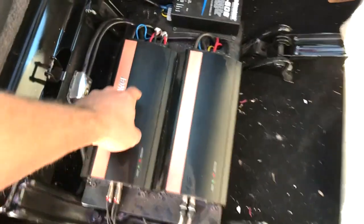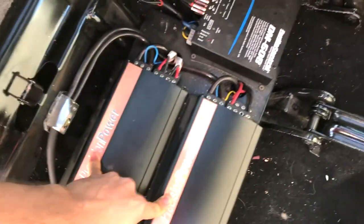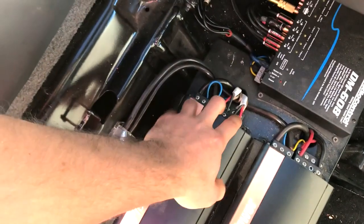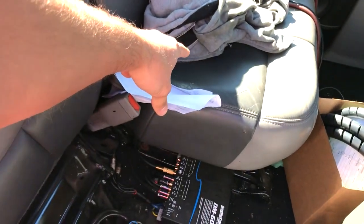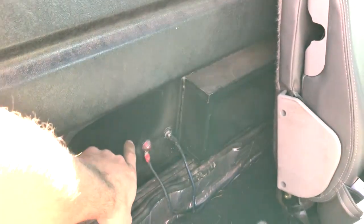These are dual 4-channel amplifiers and they're really underrated — super cheap but really good quality. I did a lot of research on these. They're running my front door woofers bridged — left channel and right channel. Then my tweeters are on top of that one, and my rear speakers are on top of that one. Then I have my Rockford Fosgate BDCP 2500-1 under there. And back here is my ported box — two 15s in a fourth-order bandpass box in the back of the truck, ported at around 50 Hz.